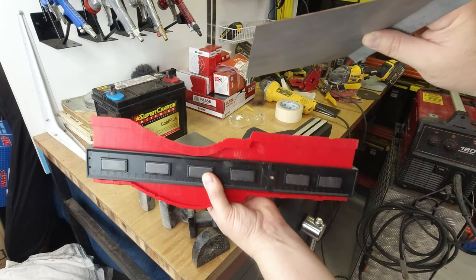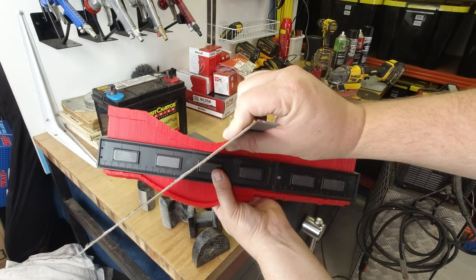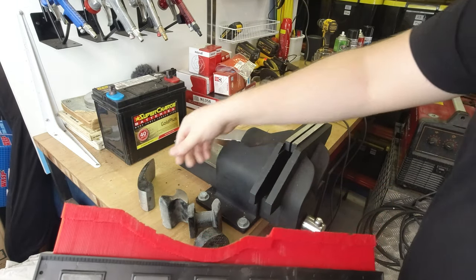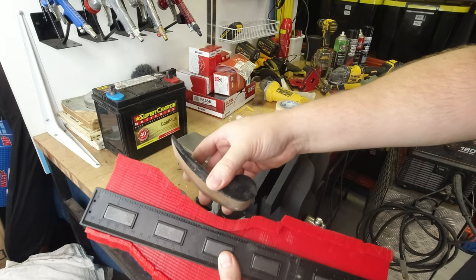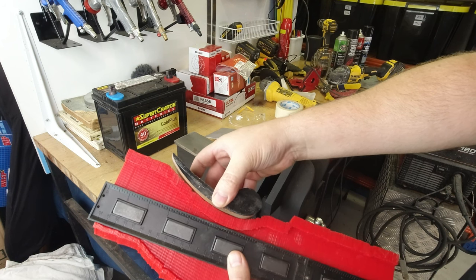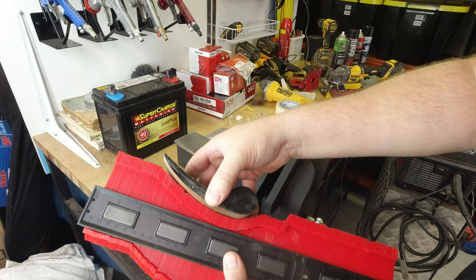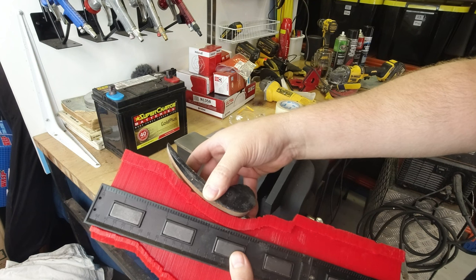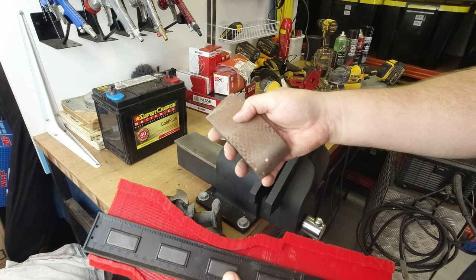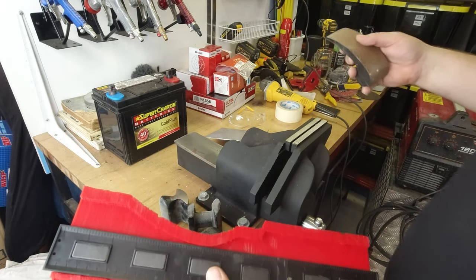So we are looking to get, if I get this in front of the camera right, that kind of bend onto it, okay? So what we can do, we can look at something like this and see how close we get. So that's not going to be too bad actually. If I was to wrap that steel over this and only wrap it to say, only wrap it over the top two thirds, that's going to give us close to the curve that we need. And I just need to do that far enough out. So we'll try that first. We'll try this one.